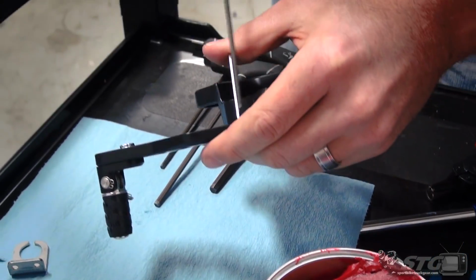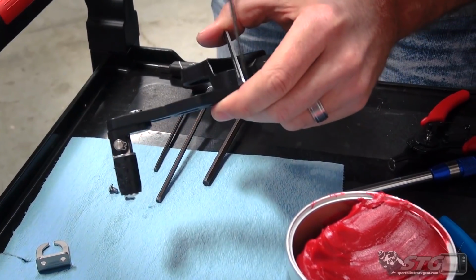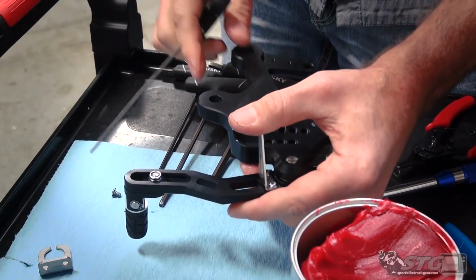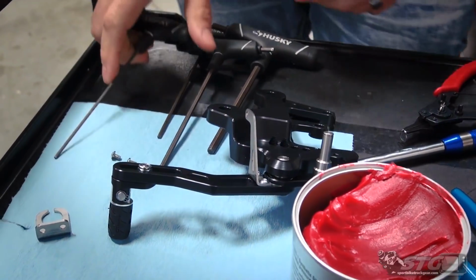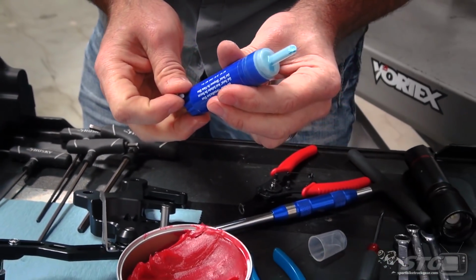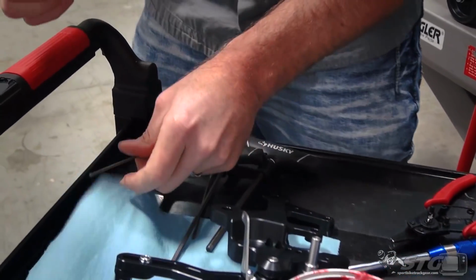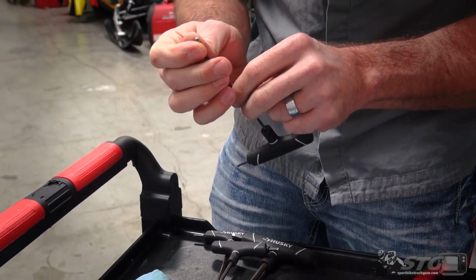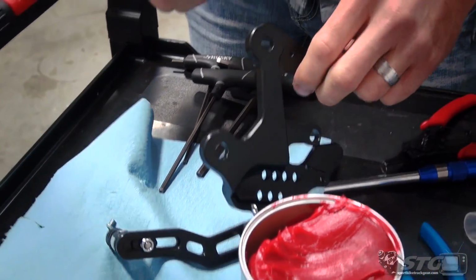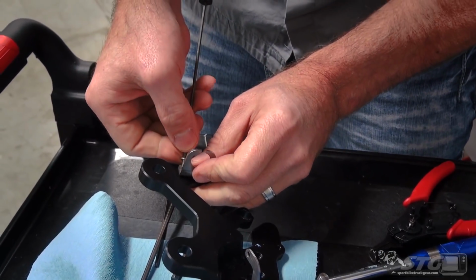It just helps to go the extra mile, especially on a street install. So we'll bolt that bracket on like so. It's a tiny little fastener. You don't need a ton of torque. And then we have the bracket that's going to hold the actual switch itself. That mounts up towards the top of the footrest bracket. Like so.